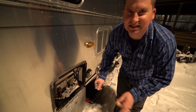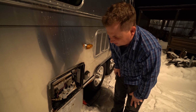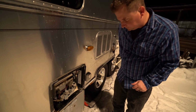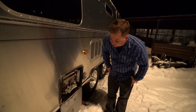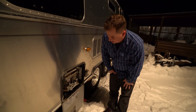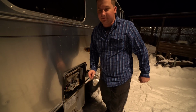That'll leave a nice icy residue tonight. It's 24 degrees here. It's gonna get down to 8 tonight. We'll make sure to dry that up. This is a 6-gallon hot water heater, so that's gonna be 6 gallons of water. Just think of a paint bucket plus a gallon of milk. All right, that step's done. We'll leave this draining while we go do the next step.